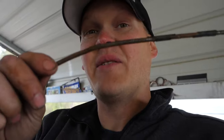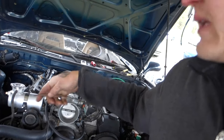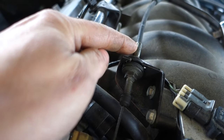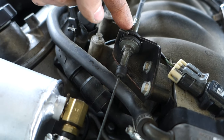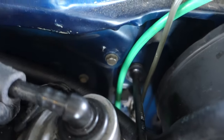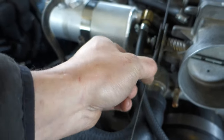One cool thing about the RX-7s — even the FC turbo car — is that it has a really long throttle cable. You can save yourself about a hundred bucks by just cutting down the factory cable. It's pretty straightforward: cut the wire stop off the end, pull the wire out of the cable, cut it down. If you pull the wire out before cutting, grab pliers, pull it out, hammer the flare out with a piece of solid stock, slide it back, re-crimp it, and use it. Then just grab a screw-on wire clamp from O'Reilly's.